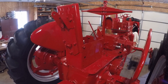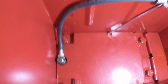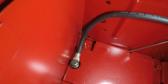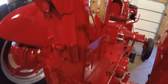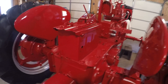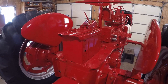Here we have the battery box and the cover installed on the chassis right now. I've been to the parts store and purchased a new ground strap. That's part of my bracketry to hold the box down, and the bolt that holds the box down will also be utilized for the ground for the battery. Got that installed, got the cover on. A seat still needs to be installed on it, but that's another project coming up. Battery box is done as far as I'm concerned - got a little bit of paint to do on the hold-downs, but other than that we're done with the battery box assembly.